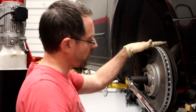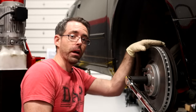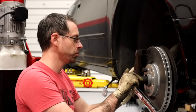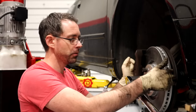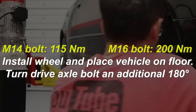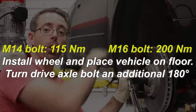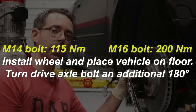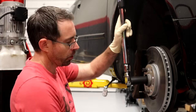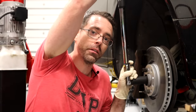So now we're gonna tighten our axle bolt. Now, this is something that a lot of you might do by taking the center cap out of the wheel, holding the brakes, putting the car on the ground, and tightening this with it in the car. You're not gonna wanna have too much torque on this caliper and the rotor itself — you could damage it. So what we're gonna do is we're gonna do our initial torque — we'll put that initial torque on screen — and then you're gonna be doing a partial turn. We'll show you degrees on screen after that. You have 360 degrees in a circle, so if it's 180 degrees, you're gonna be going one full half turn all the way around. So we're gonna do our complete turn and finish up our install.